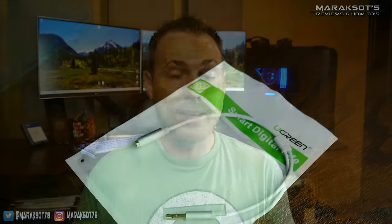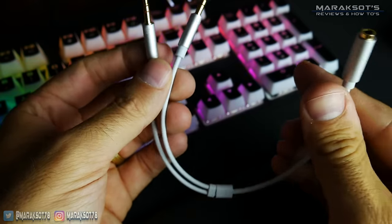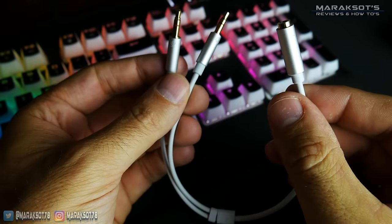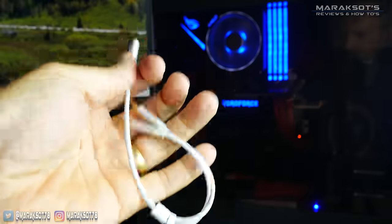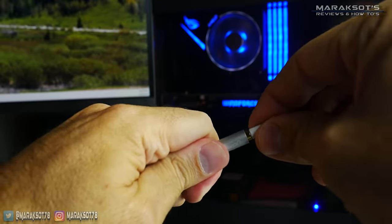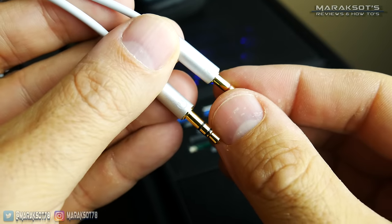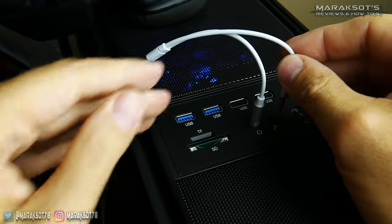The pinout on the three pin and four pin plugs for the headphone audio is the same, so of course the sound works fine. The problem with plugging a four pin headset into a three pin jack means there is nothing in that jack to read the mic input. In order to fix this problem, you need a four pin to three pin splitter like this one. This splitter takes your single four pin plug and separates the mic and headphones, converting them to three pin plugs. Now all you have to do is plug your headset into the splitter and then plug the end marked as the headphones into the headphone jack on your PC and the end marked mic into the microphone jack.